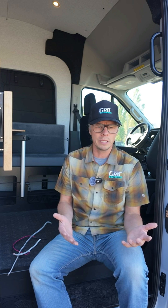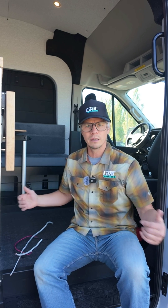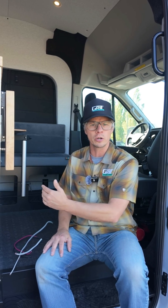The last thing I wanted to cover in this video: oftentimes, we used to have a service center here that would service all kinds of different RVs and camper vans from many different manufacturers. We would often open up cabinets and see just spaghetti wires everywhere. The problem is all of that extra wiring adds to voltage drop. It's like pushing the same amount of volume of water through a garden hose — if it's really long, the water pressure drops at the end. The same thing happens with copper wire. So what should really be happening is cutting the wire to the length it needs to be, which is what we do here. That way you're maximizing the functionality of your device at the other end of the wire.